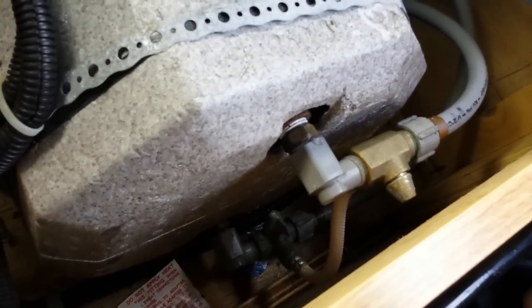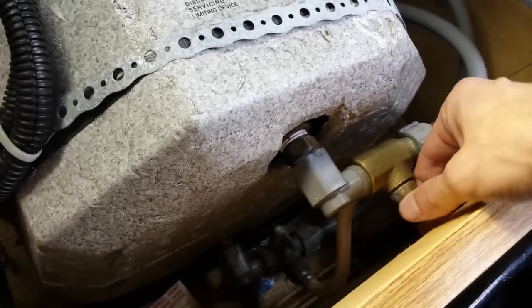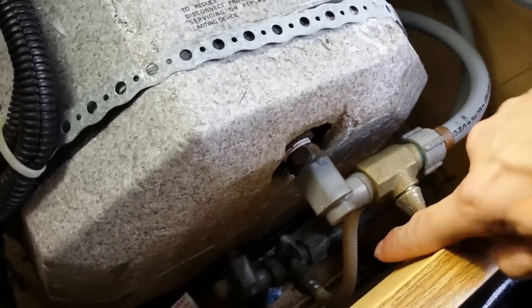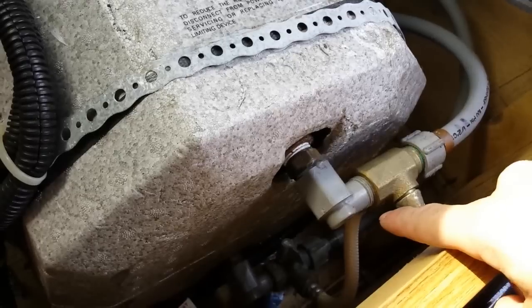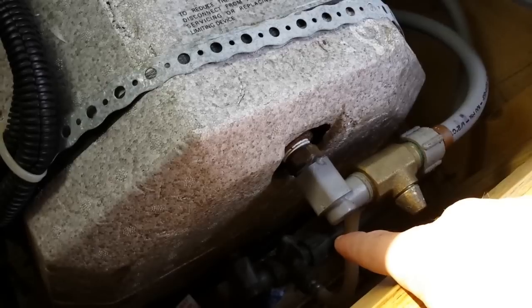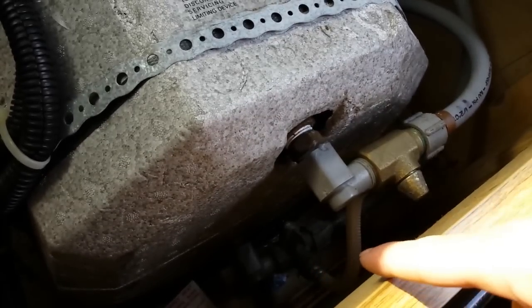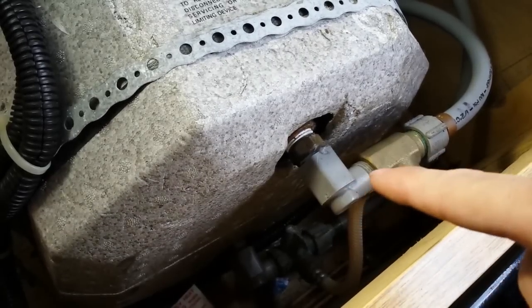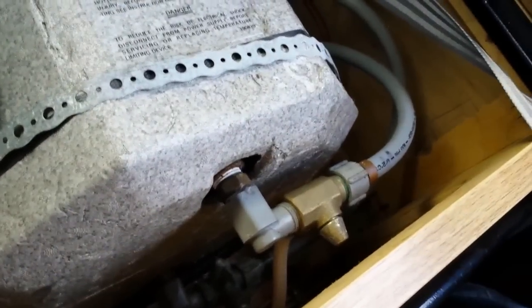There's the hot water tank. This is probably the hot water line, and the cold water is down at the bottom there. This here is the valve I'm talking about — it's already shut off, so it's directing the water into that connecting line, which goes down into the cold water. So when I start pumping antifreeze, it will come in the cold line, and instead of going into the tank because I've turned the valve, it will go up the connecting line and directly into the hot water line, then run off into the remaining lines in the van.